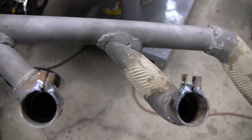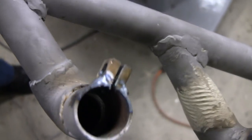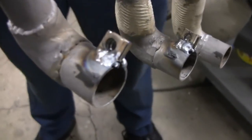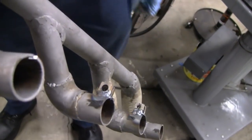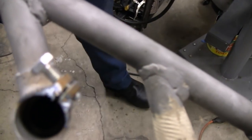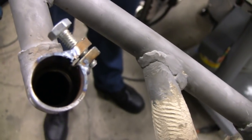Alright Tubes, this is what we're trying to accomplish here. We're going to weld little nuts on the bottom here, so when it's on you won't even see them on the machine, but we're going to put cap screws in there. See if a bolt will fit in there Racer. Let me show them that weld — I don't know how you did it but it's pretty good. See if the bolt fits. Oh, that's good — that's what we want. We're going to use cap screws, but that's what we're trying to accomplish here so it actually clamps on there.